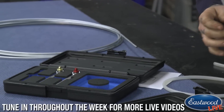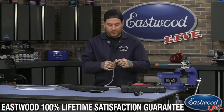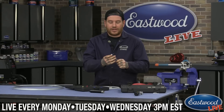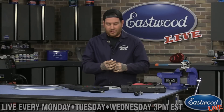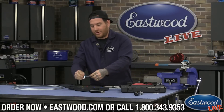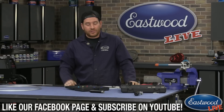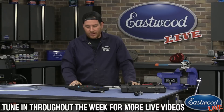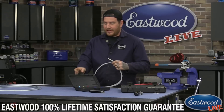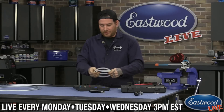It's a simple little wrench, a hose, and a check valve — and you can bleed brakes by yourself. Even if you do have a helper and don't necessarily need the check valve, the great thing versus using a normal wrench is you can hook a hose to it and you're not going to get brake fluid all over the place. It also comes in 8, 10, and 11 millimeter sizes, which covers the most common bleeder sizes and the majority of vehicles out there, whether you're working on an older car or something new.